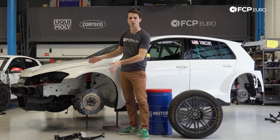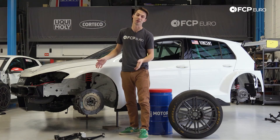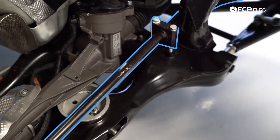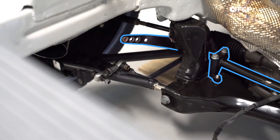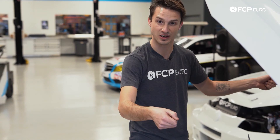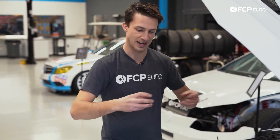We've talked about the suspension mostly on one corner of the car, but we also need to talk about how the suspension on the left side is connected to the right side — and that is through the sway bar, otherwise known as the anti-roll bar. The sway bar is mounted in the standard location right on top of the subframe. On a race car, the sway bar is hollow and has welded-on blades at each end with multiple holes, allowing for very quick adjustment on the same sway bar. The sway bar literally links the right side control arm to the left side control arm. As the suspension on one side goes up, it pulls the other side up, keeping the car from rolling over too much in the corners. The bar has a torsional spring effect — it's not a one-to-one rigid link; the bar twists as force is applied, and the stiffer the bar, the less it allows twisting.